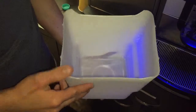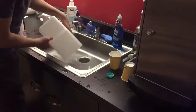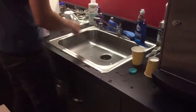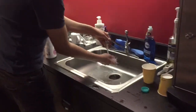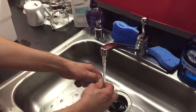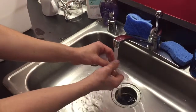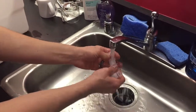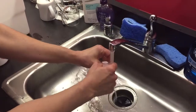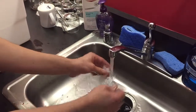And now, let's say we're coming back from the weekend, we dump out the cleaner into the sink and the heads, and then we rinse them with cold water in our hands, get all the cleaner off of them, make sure there's no milk residue, just rinse off. Every surface should be perfectly smooth. And we just want to make sure there's no residual milk on here.